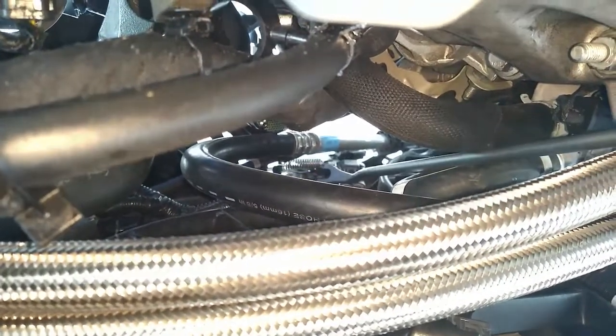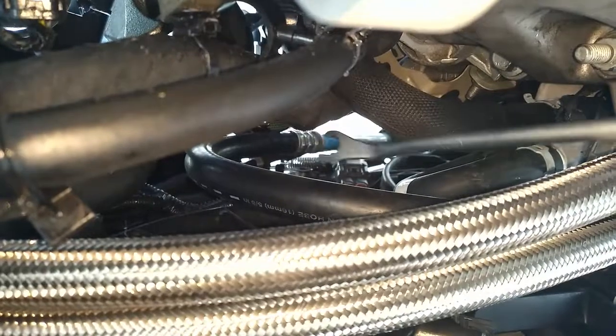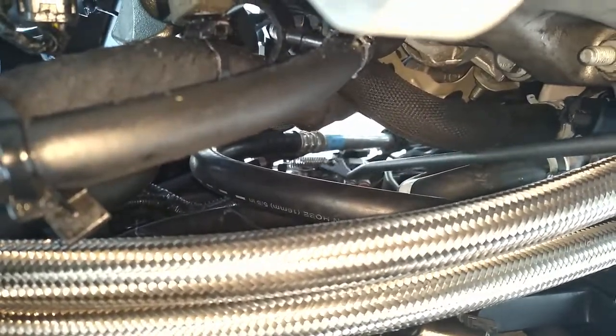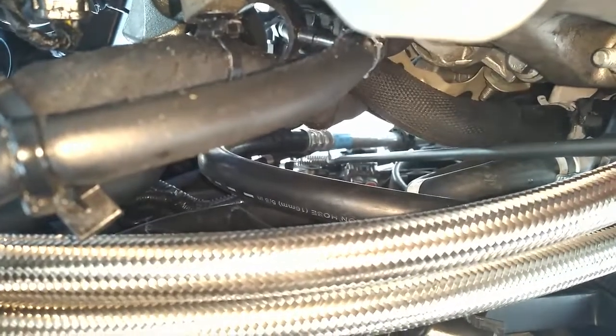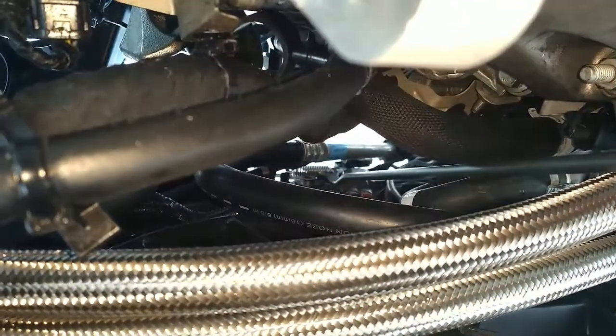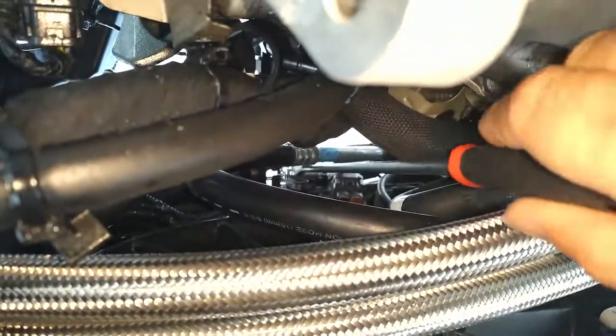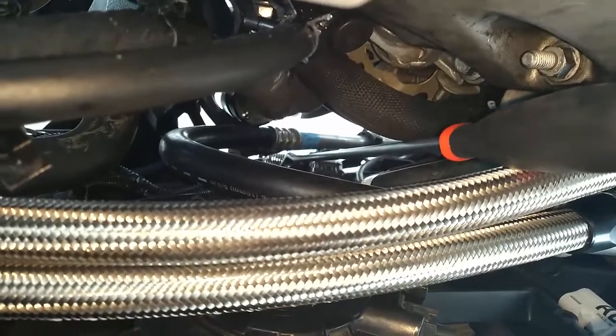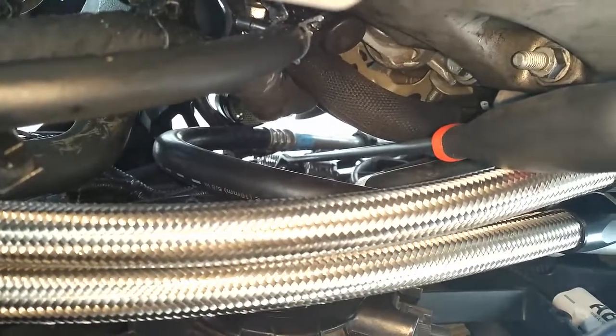And these barbs, you want to get the most open trim panel tool that you have, because you just get lucky and grab that little slider part. And I had to face it this direction, get it over the spring and twist it, and then slide it over. It popped right open. Once I had the right tool, literally took me about 20 seconds to pop the hood.